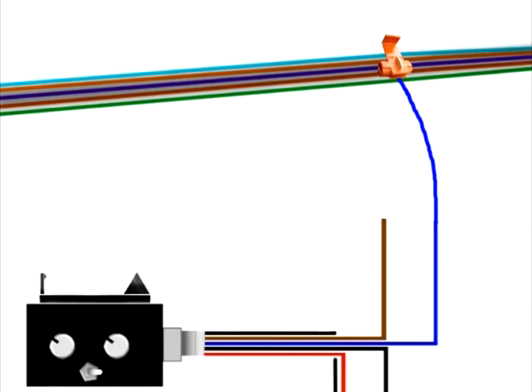Now we have the brake lamp wire connected to the blue wire from the brake lamp module. Next, connect the dark brown wire from the brake lamp module to the running light wire or interior light wire, whichever your instructions call for. In the instructions that came in the box, the wire should be noted as either headlight, running light wire, or interior light wire. You'll attach it exactly like you attached the brake lamp wire, using a red clamp.